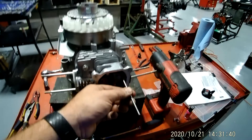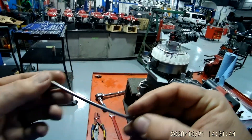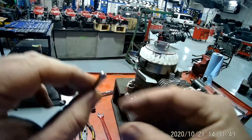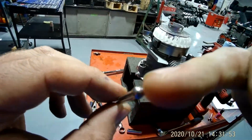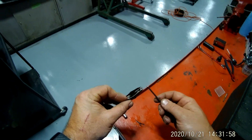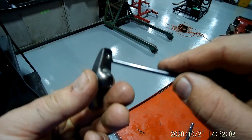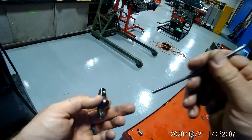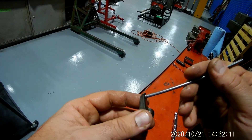I'm going to take out my push rod. If you look, this push rod is just a metal bar. In automotive application you're going to have a little hole right here, and what that hole is for is for oil to transfer through so it can hit on the back of the rocker. This rocker has a little indentation — that's for your push rod to sit in. In automobiles they have a hole in either end most of the time, and that puts a little lubrication up there.